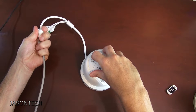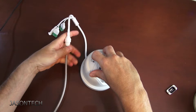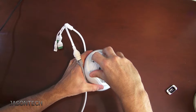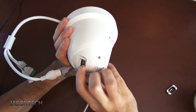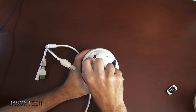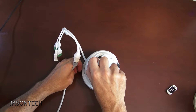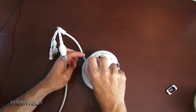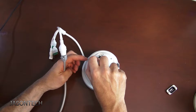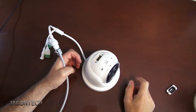Now we're gonna plug this back in. I'm just gonna hold it for a few seconds. Usually there's a little light — this one doesn't have one. Just to be safe, I would hold it for about a minute. You will hear the camera give you a little click usually when it does it — that means it's rebooting itself. There's the click — I don't know if you guys heard that.